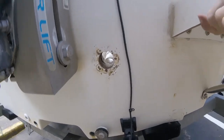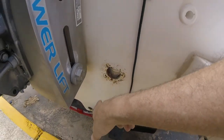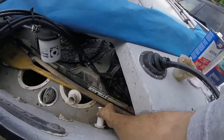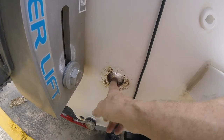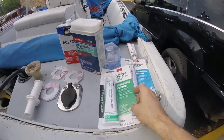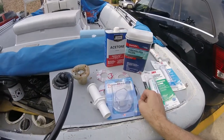Not a good problem, but here's what I'm going to do to fix it. I'm going to take some cheap Bondo fiberglass resin and acetone, thin it down, and scrape all the crud out of here. I'm going to turn these around and put them in from the back side with aluminum washers, bring them out flush with the hole, and after the resin dries I'm going to fill that with 5200 or 4200 — I haven't decided yet.